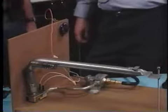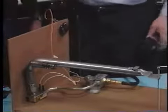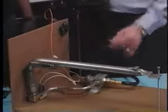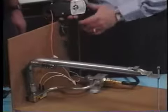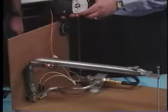Well, Dave, let's fire this thing up and see it working. Okay, Frank, I want to check the amps. Like I said before, the system is more amp-driven than anything. Let me turn the thermostat on and put this clamp-on amp meter in place. I see it's increasing as time goes on. We ought to see it go up to about 3.2 amps before that valve opens.